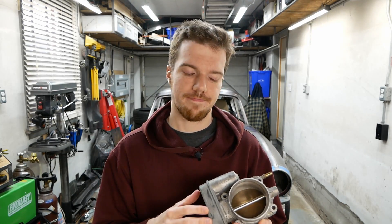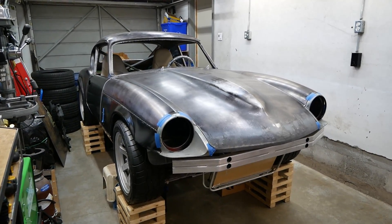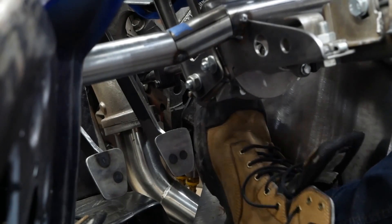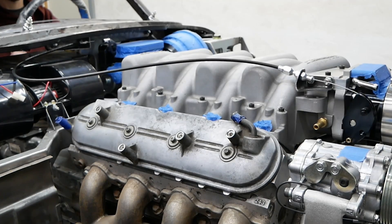Some factory calibrations can be a bit unresponsive, which despite conflicting opinions is why products like pedal commander exist. But on the whole, drive-by-wire is very advanced compared to the old way of doing things: drive-by-cable. In this setup, the pedal is physically attached to the throttle by means of a linkage, and every time you ask for power, you get it.